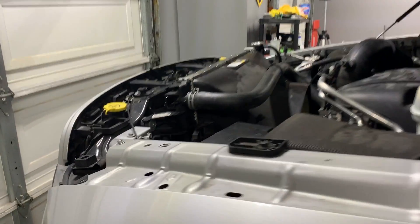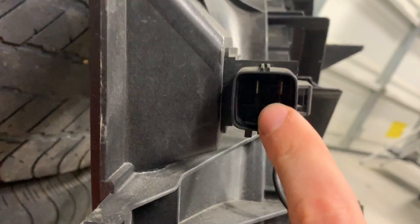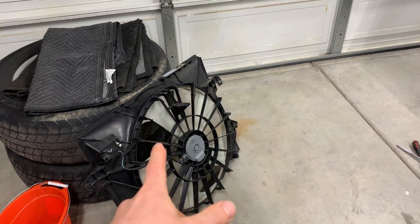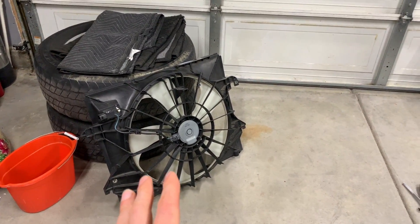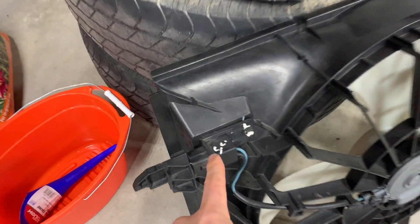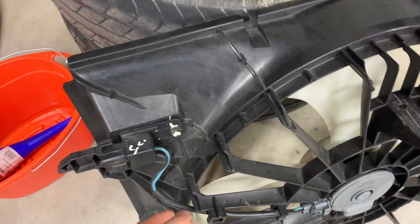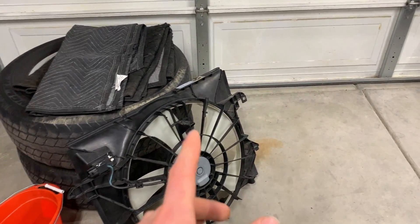You can bolt this right up, take off the mechanical fan, take off the electric fan. As you can see, this connector is a square four-pin connector, but only two of the wires are used. Make sure you order a V6 fan from a 2009 to 2012. If you order a 2013 and up V6 fan to put on your Hemi, this plug will be different — it's going to be an oval style plug and a different setup. So even though it'll bolt up, the connection is completely different and you'll be left trying to hack up your wiring harness. Make sure you get a 2009 to 2012 V6 fan.